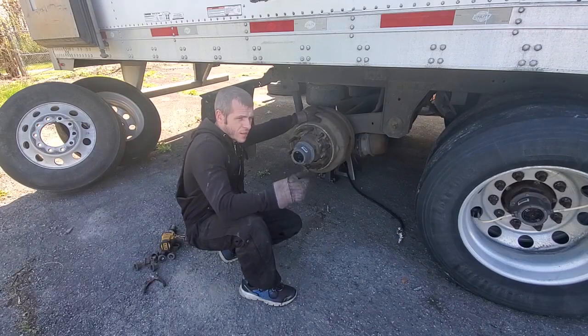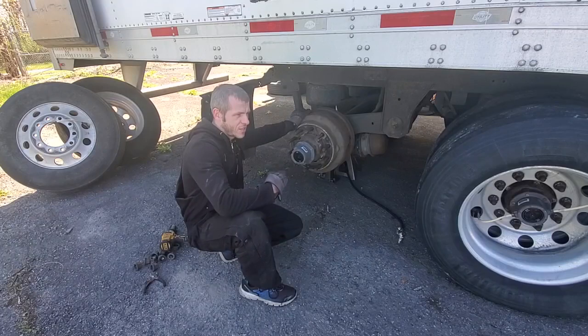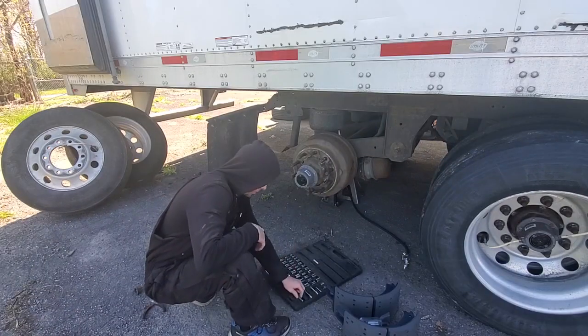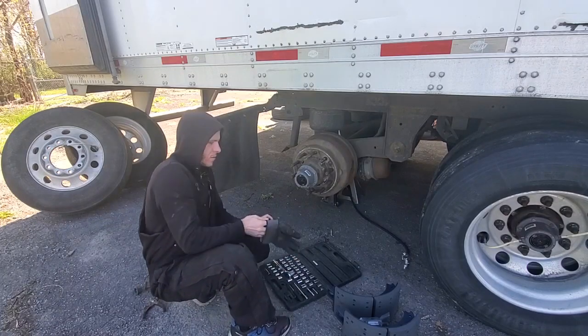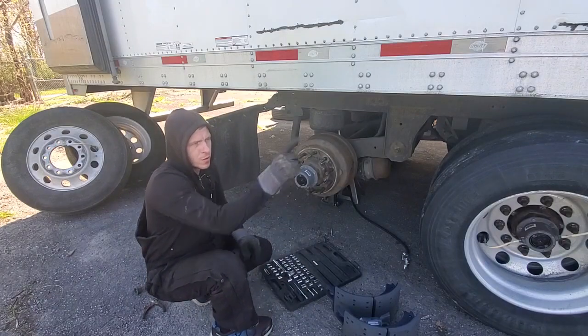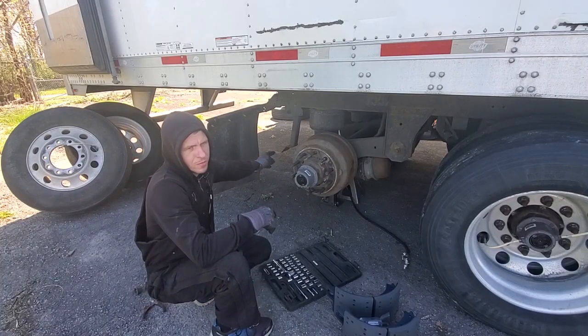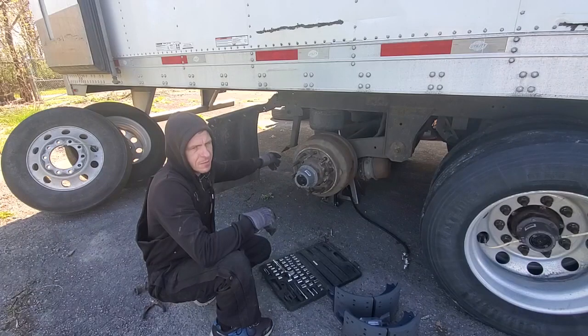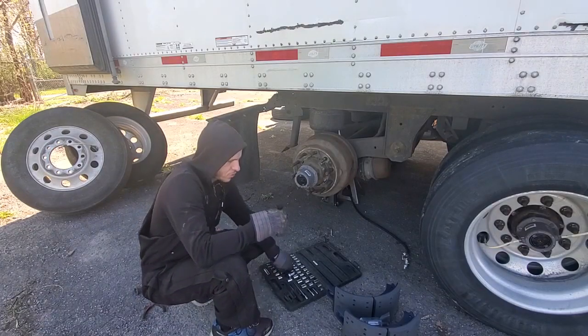Then you have to release your brakes in a tractor and release them even more on a ratchet. When brakes are released, you gotta release the adjustment of the brakes. Remember to do first push red button inside the truck, then try to adjust them here, because if you do the opposite, adjusting first, it's gonna be so hard to move it, you may not even be able to.